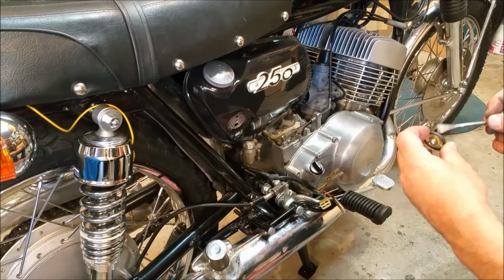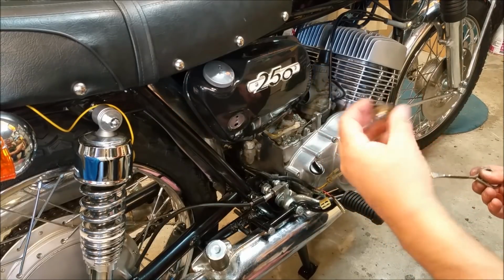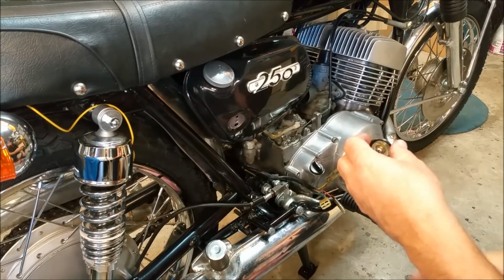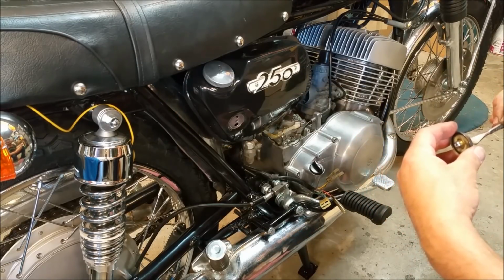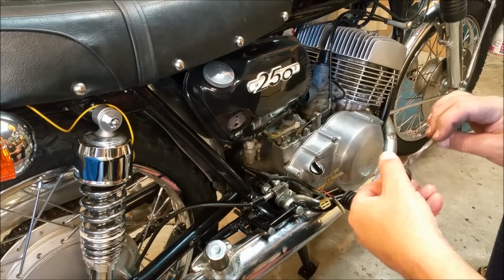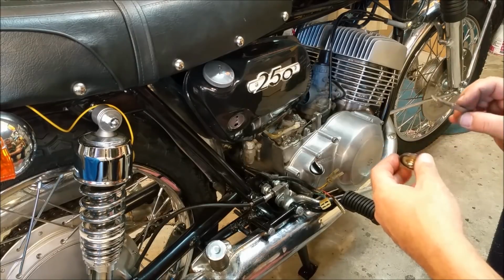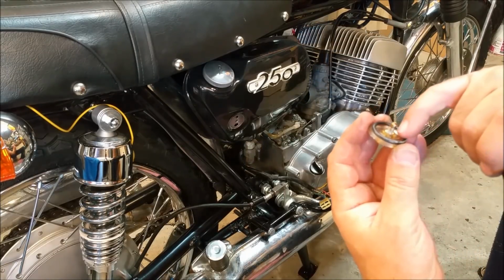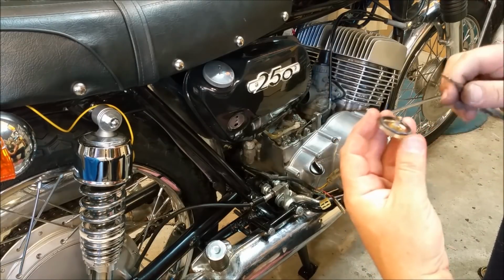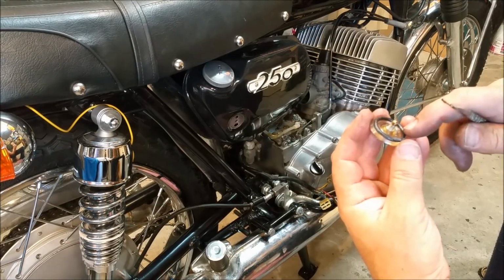Because this goes into the oil tank. And you can buy these windows. That's not bad, Nick. It's a bit discoloured, but I don't think it's worth replacing. This will seal that hole where the thread goes into the oil tank and will stop oil leaking out. I'll get my Aldi O-ring kit, which has proven to be useless, and I'll just put an O-ring there as well. I think there's meant to be one there. That'll seal it up, because there's going to be oil around here, and I don't want it coming out where the screw comes through.